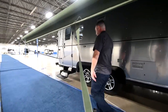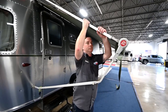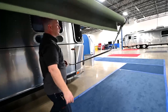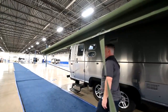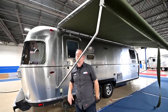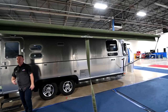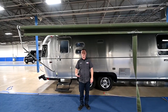Come down here to the other end. At this point we can start to extend it. You've got four of these little notches and you can do two at a time — I'll typically start with one and come down and do a couple, then come back to the other end and finish it off. Now you'll notice how I've got the awning at an angle. This awning is a sun shade, so if you have more sunlight coming in from one direction having it at an angle is totally appropriate. This is not a heavy wind or heavy rain shade — it's made of aluminum and designed to be lightweight. It cannot take the torque of a heavy wind and heavy winds always accompany a heavy rain, so if it starts to blow or pour, make sure you fold it back in.